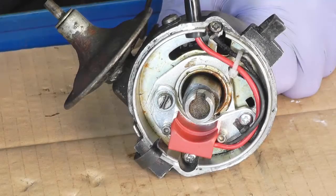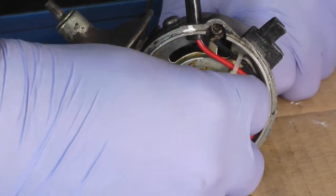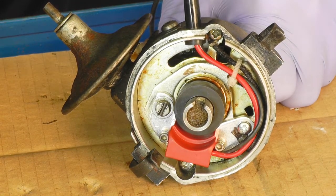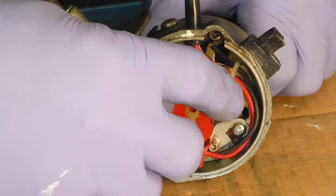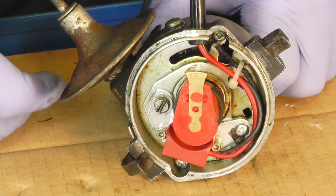We have the magnetic piece we need to fit onto the centre shaft. Make sure it's lined up with the lobes and it should just slide on finely, and the rotor cap needs to go on. Then turn it around so that it lines up with the Tippex mark so that we can refit it back the way it came out.